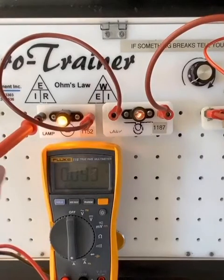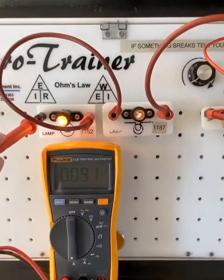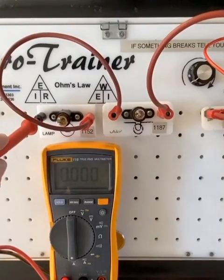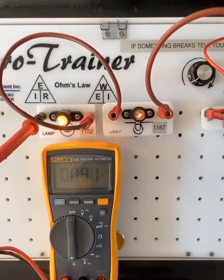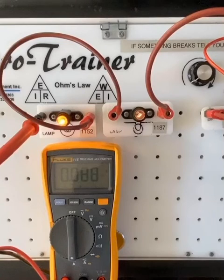With no connection we see zero amperage flow, but with connection we've got roughly 0.091 amps. If we lose continuity, we have no amps — no continuity, no flow. That's what it looks like in real life, and this is how we'd perform a parasitic load test on a vehicle. That's amp testing in a nutshell — leave any questions in the comments and I can go ahead and answer them.